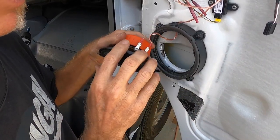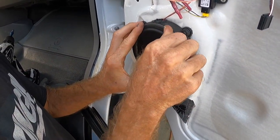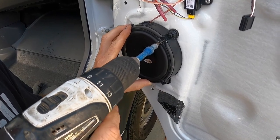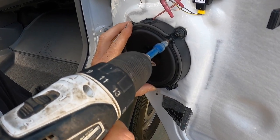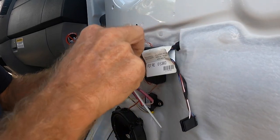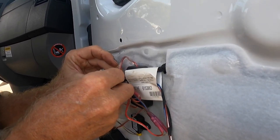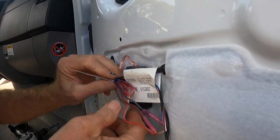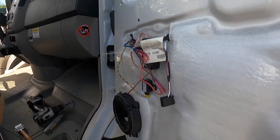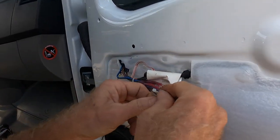This is attached in the factory mounting positions. That's going to go right in here and I'm going to screw right into this. Now if you're using a power drill, be very careful you don't slip and go through your speaker — that would be tragic. Just to make things a little neater, I'm going to get these wires up out of the way and tie wrap them right here. I checked the back of the door panel — seems to be plenty of space right here, so nothing should be in the way. Might as well tie wrap this to there to get it out of the way. Let's try to make things a little neater back here so we don't get any rattling.